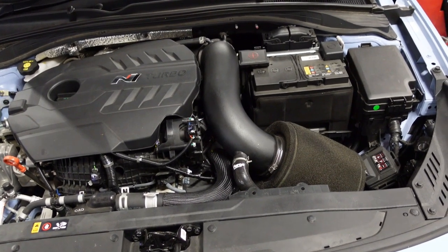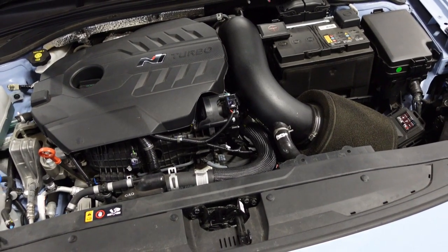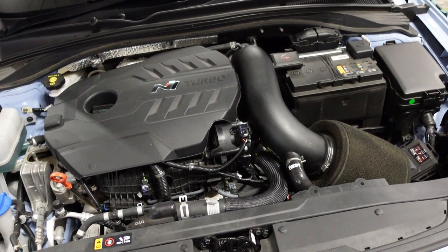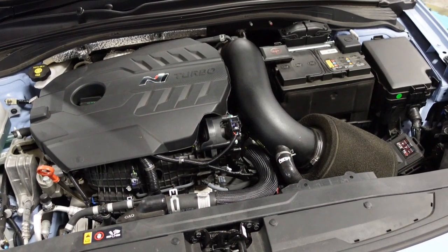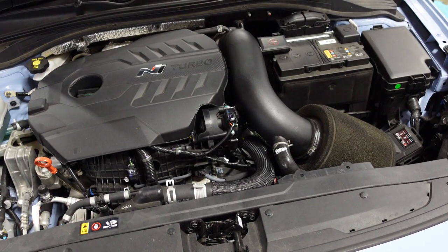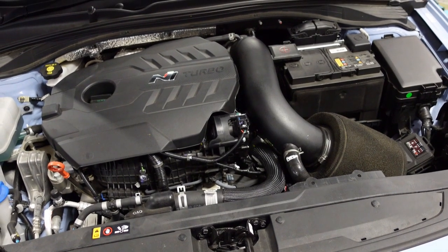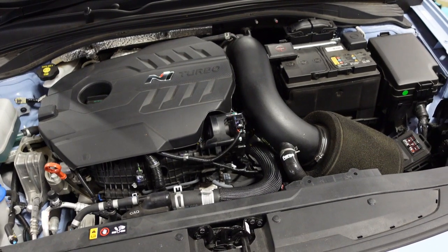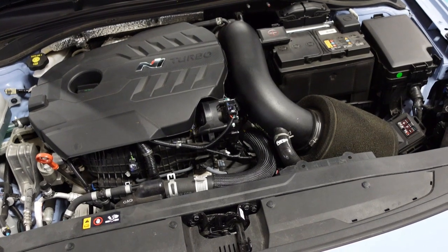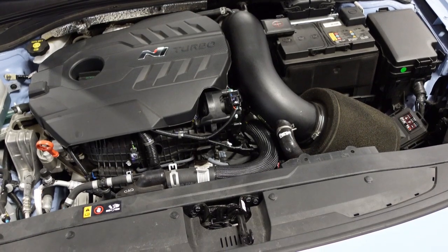It's got a DTUK tuning box. Like I said before, this was dyno'd at 325 brake at a local well-known establishment, GM Imports. Big shout out to Jürgen there. So it's quite impressive. The DPF's been removed. We've also got a larger rear section of the downpipe. That's been increased to 3 inch. And we're looking at doing a 3 inch midpipe as well. And you've already heard it. It sounds quite good. So stock, it's pretty decent.